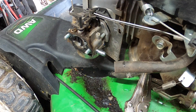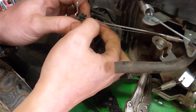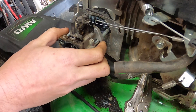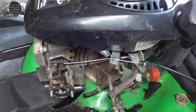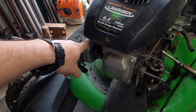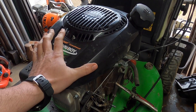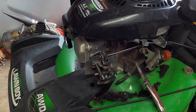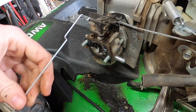I'm going to dump that fuel into the container and get this taken off. Usually we have to take off the choke on the other end, and this is no different. On this end there's a choke mechanism bolted to the exhaust. I'll take off the three screws holding the recoil down — after that this whole cover comes off and we can gain access. Then just two 10-millimeter bolts to remove the choke. You don't have to remove it, but it's just easier.